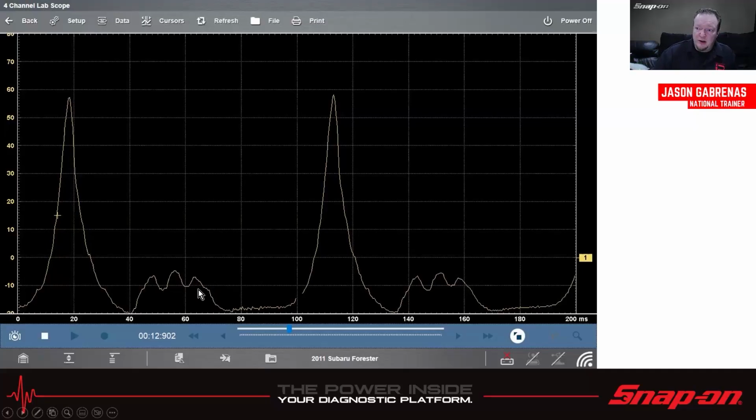Get little bumps there. And then we'll have a little bit more valve overlap over here. And then we'll have the intake come in, comes down, pull the vacuum pocket, and then we compress that air-fuel mixture up, and then we do the same thing back again. You should be doing a running compression test with the plug out.